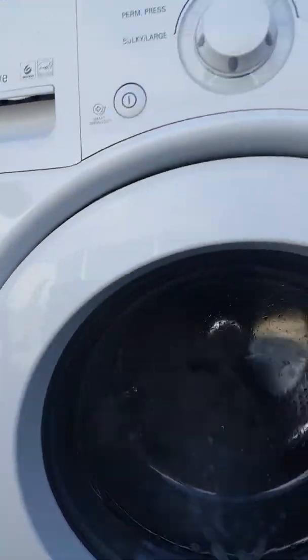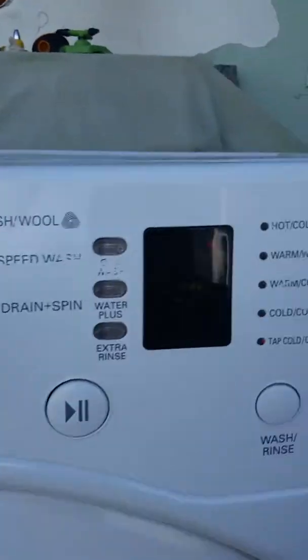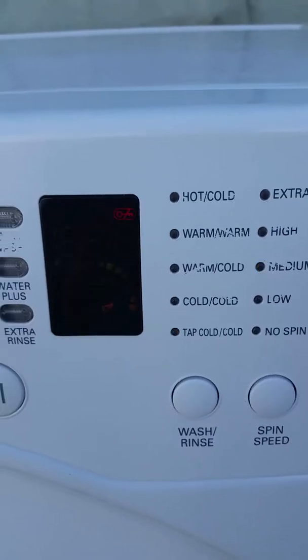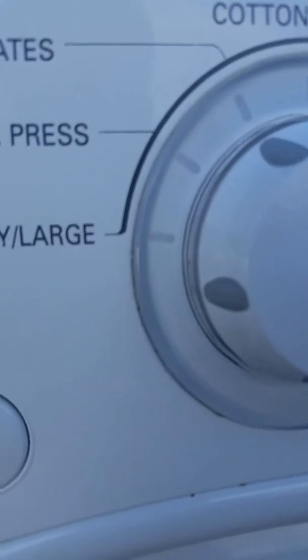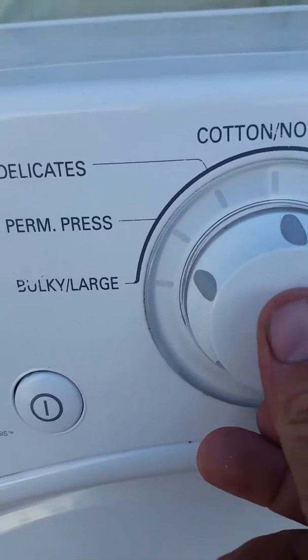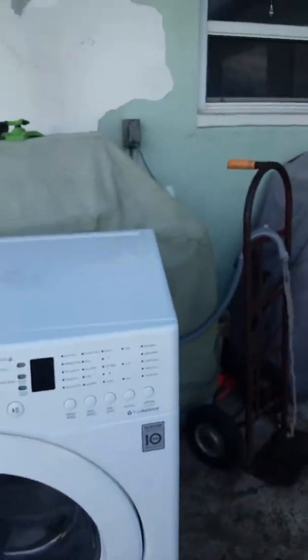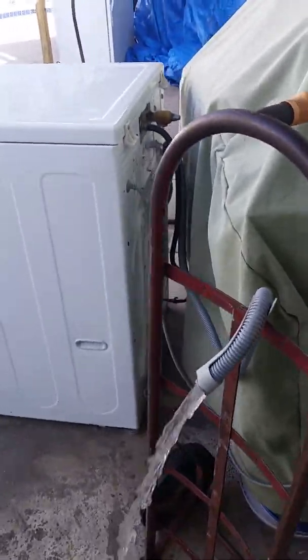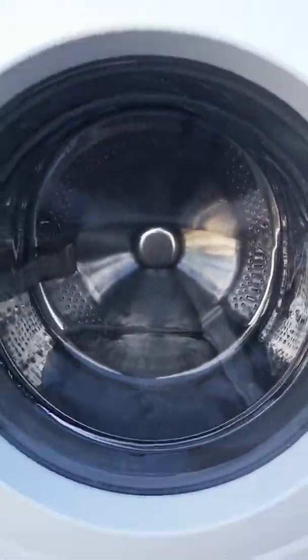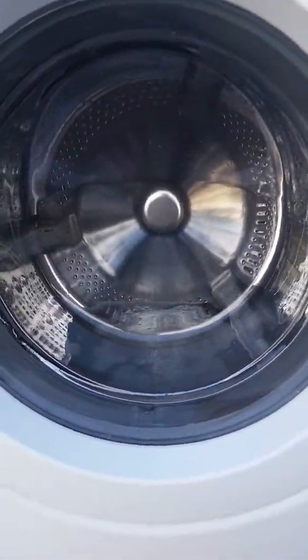We're at two minutes and 40 seconds, so I'm going to shortcut ahead. I paused it — as you can see all the lights work; they're flashing due to the camera refresh rate but those are solid orange. The function light works too. I've moved it over to drain and spin mode. There it goes — water coming out. That is the hose attached to this washing machine, and like any HE washer it pumps all the water out first. You can see there's no problem with the pump — it's got a good solid stream, not obstructed at all.